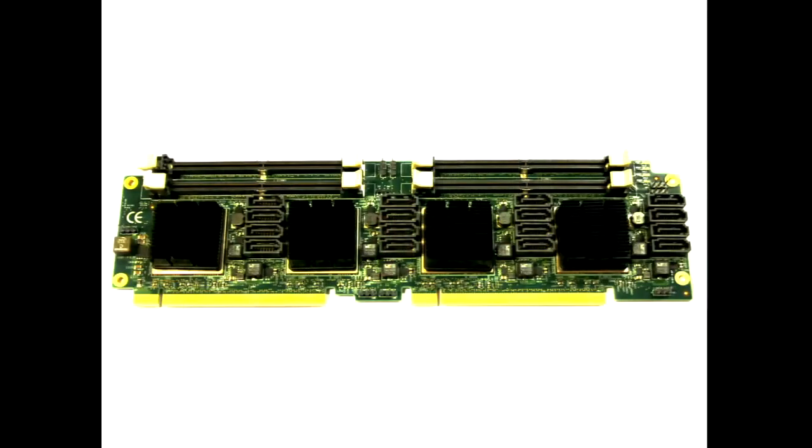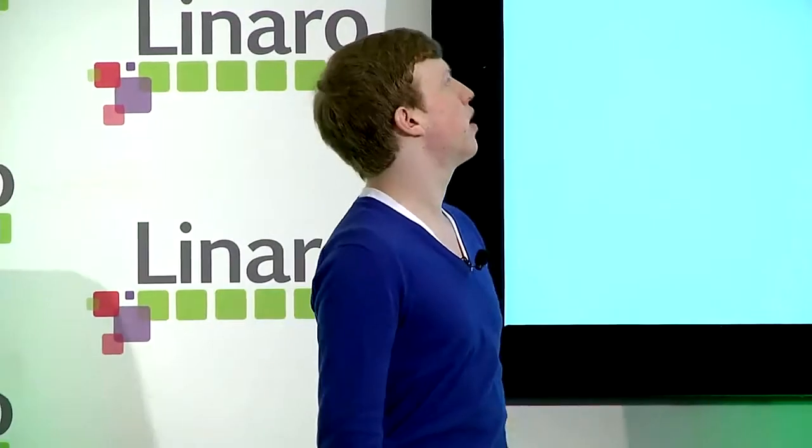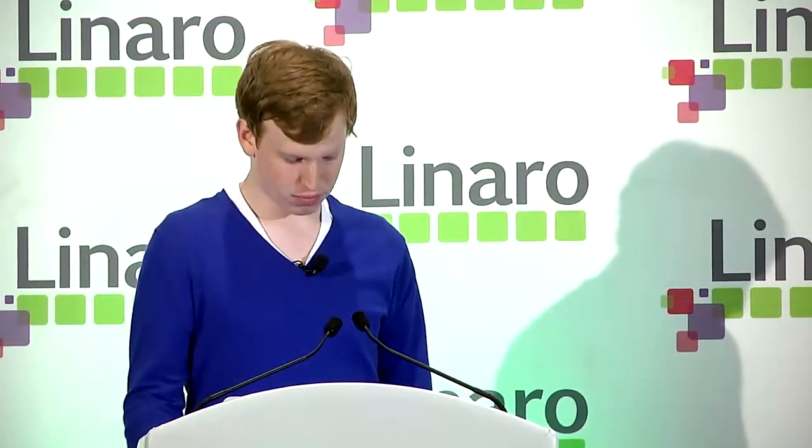If you take a closer look at one of these EnergyCards, you can see one lying on top of the server right there, and if you take off the baffle, you get this little thing. On this card, there are essentially four types of components that would be interesting to a server administrator. You have your Calxeda SoC hidden by a passive heatsink. Then you have four SATA connectors for each SoC. Every SoC also gets access to one mini DIMM slot in which you can fit DDR3 memory. And of course, you see a pair of PCI connectors by which every EnergyCard connects to the main board.